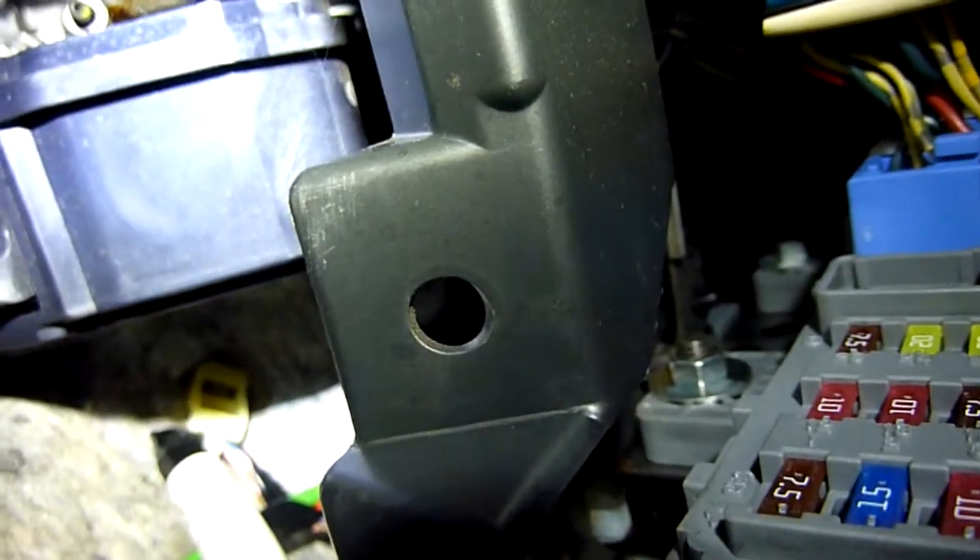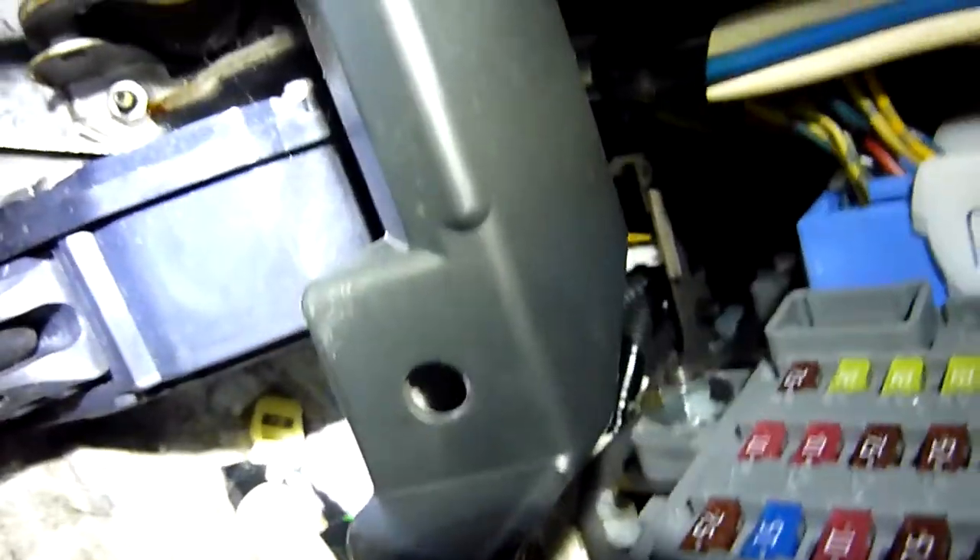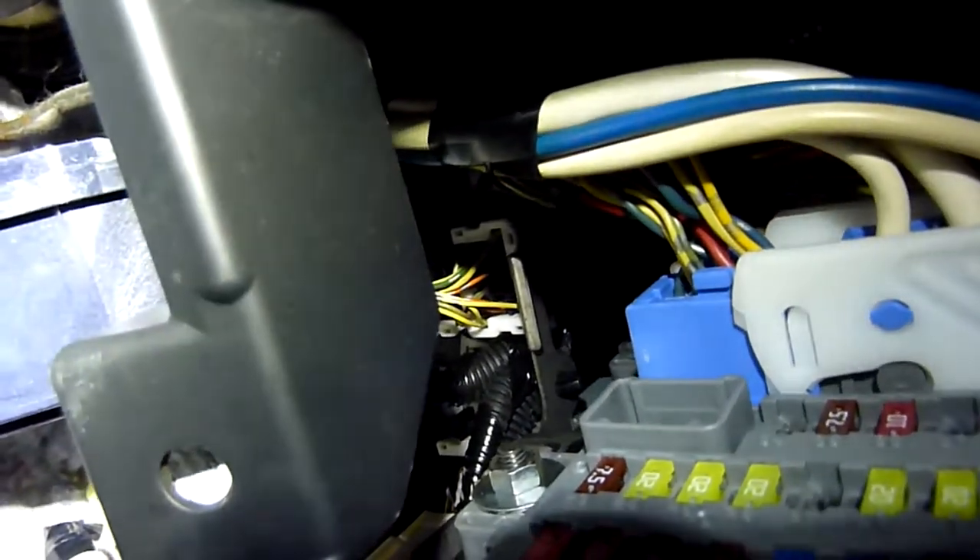So I'll switch on the car, make sure it's not in gear. I've got my finger on the demister button for the side mirror. Listen — if it stops clicking I might have better tell you. It's still clicking — it wasn't doing it earlier. That's what I want. Hear that? So in there, in there — there is a relay. In fact there's three relays.